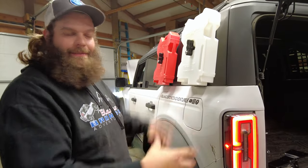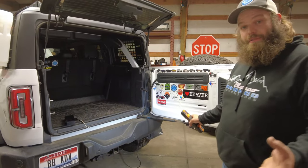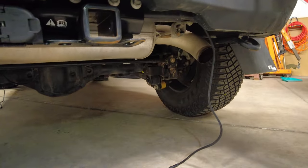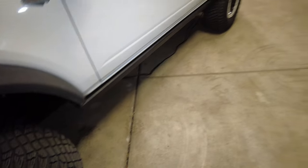The white light — the blinding one — we're going to tie that into auxiliary four because when you're out on the trail you need it. They send you a sweet wiring harness. So the first thing we do is run the wires and get everything positioned. We've got our wire drop for the passenger light and the driver's light, then the cable routed the entire length of the Bronco. We dropped a stick down through the wheel well and pulled it up. They give you plenty of wire — it seems like it's meant for a truck. Now Monica gets to lay under the dirty Bronco and tie up the wire with zip ties.